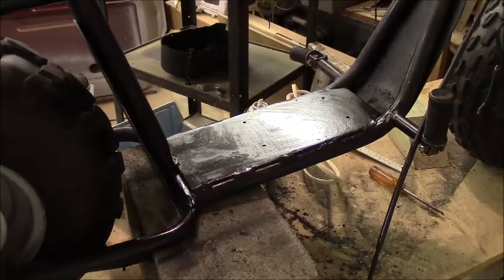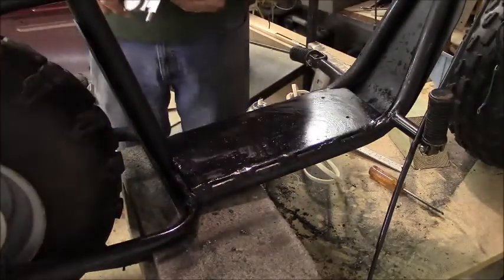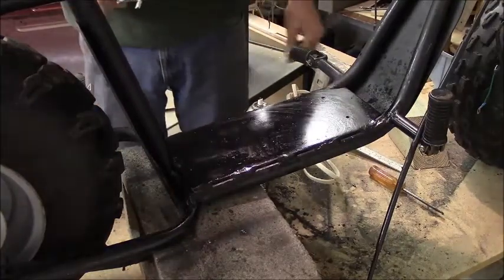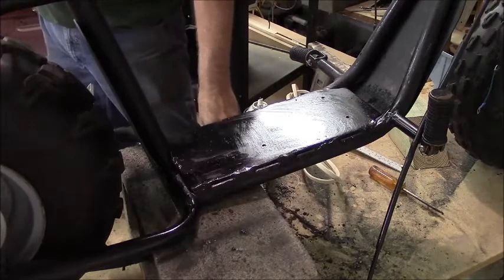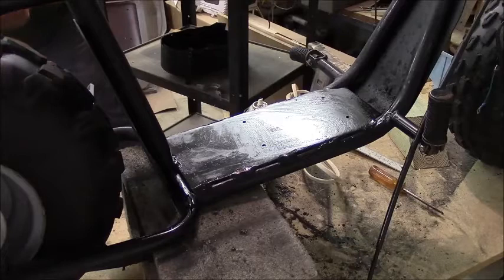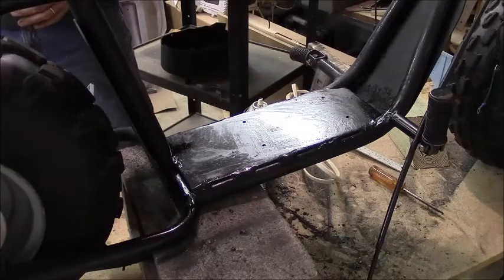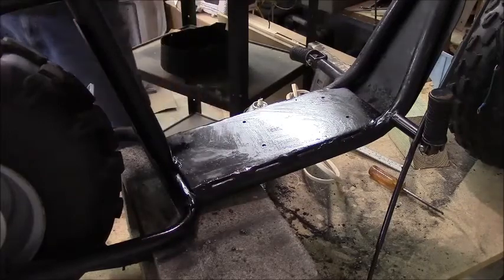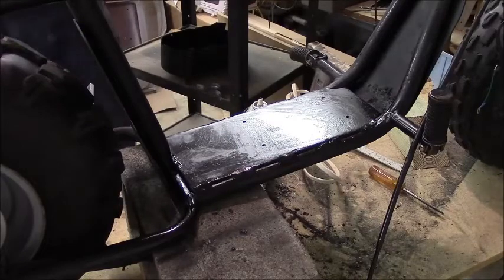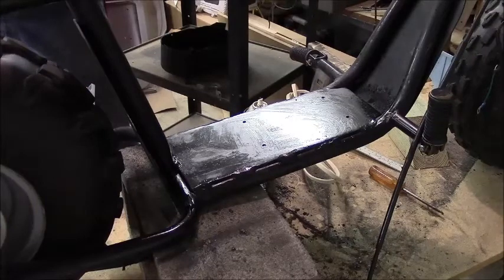All right, well, I got one of the supply engine bolts here, and it measures 0.309. I figured I'm at about 350, which is 11/32. That's the size I'm going for. Give it just a little, 30 thousandths of play. If I don't like that, I can always enlarge it. I don't think that's going to hurt anything to have a little bit of play in the system.